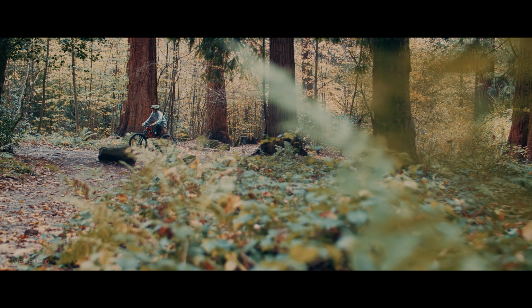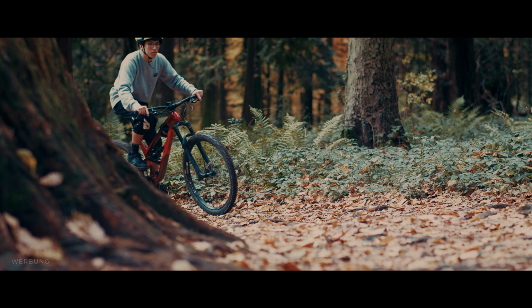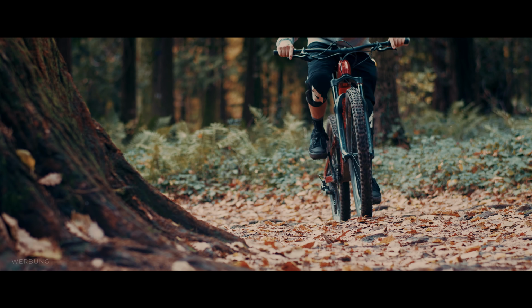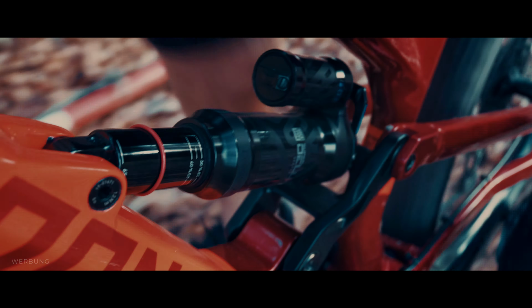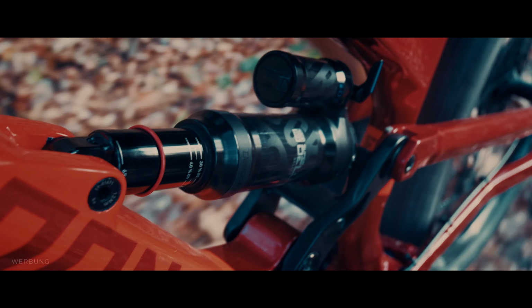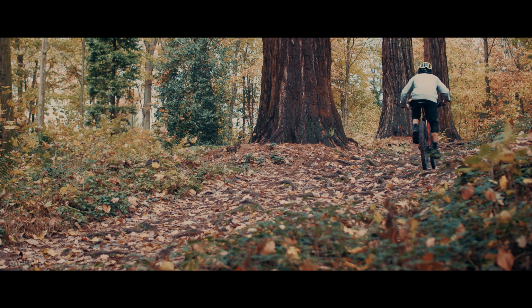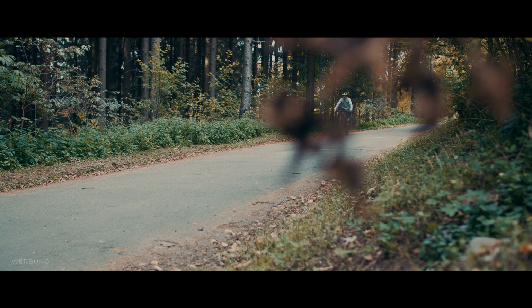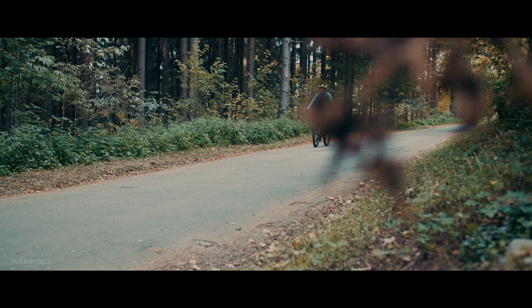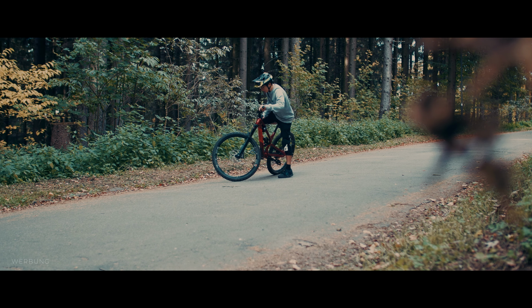The range of gear ratios is sufficient for the steepest climbs and fastest pedaling passages. The SRAM GX Eagle rear derailleur changes crisply and precisely into one of the 12 gears. The 4-pivot rear triangle is bobbing minimal, and for short uphill climbs, the easily accessible damper does not necessarily have to be blocked. For my personal preferences, the 125mm long seat post is a bit too short. Either I don't sit high enough or the saddle hits my butt downhill. The frame sizes large and extra large come with a 150mm long seat post.